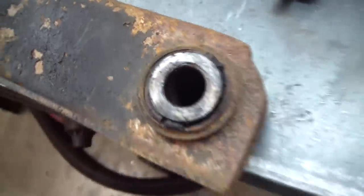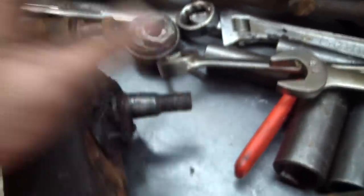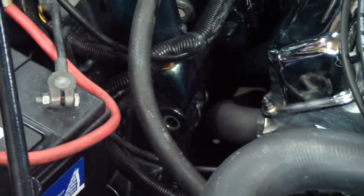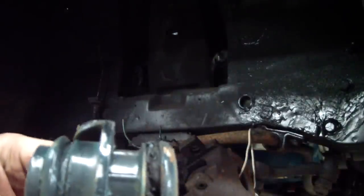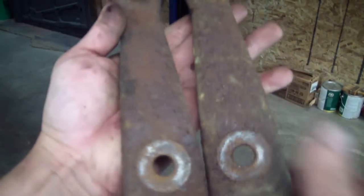That bushing back there was completely worn out — definitely time for replacement. Amazingly, this ball joint is pretty tight up front. I'm going to take the upper control arm off next, and you can see that those bushings are pretty well dry rotted. Those bolts came right out with a couple of wrenches. I'm going to mark them front and rear in case they're directional. Bushings are definitely on their last legs there. It's good to catch bushings before they completely go in case you get a kit that reuses the old bushing shell. At a glance they look identical — when I clean them up I'll see if there are any further markings on them.